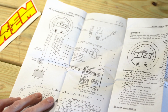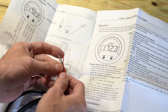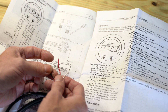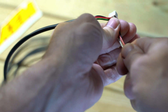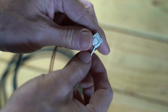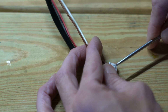Looking at the wiring harness — since I'm running the gauge solo and not using any other outputs, I really only need the power and ground wires, plus the one going to the sensor which I'll leave alone. The other pigtail has an additional brown and white wire I'm not going to use. You can tie everything up, cut it, or do what I'm going to do: depin those wires and keep them whole so I can plug them in later if needed.